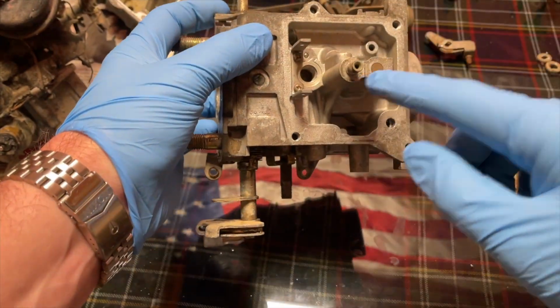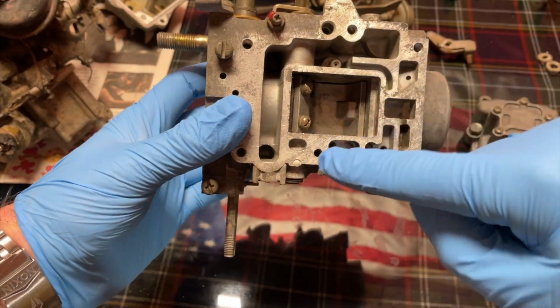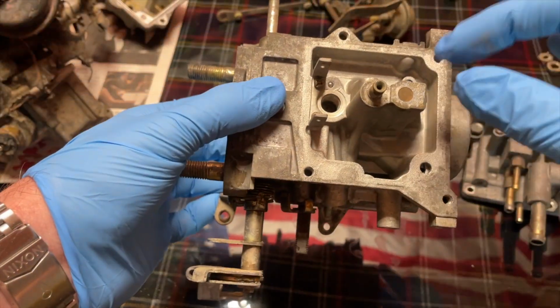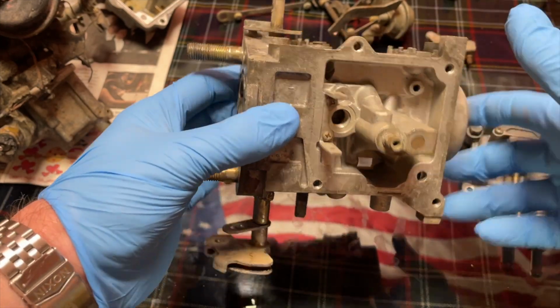Jet this needle here, that little port, all the little ports. You want to make sure you jet them out, because some gunky crap from the ultrasonic could vibrate inside those little ports and get caught. So always spray that out.